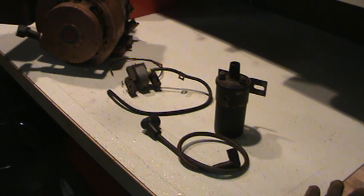Oftentimes, like I say, it's a matter of just needing to clean the flywheel, clean the surface of your coil pack, gap them correctly, put it back together, make sure that your points are clean and properly adjusted, and if the coil is okay, you're going to get spark, you're going to get fire, your engine's going to run.